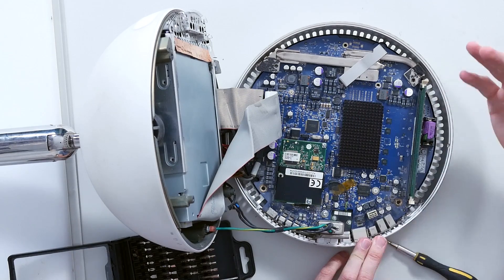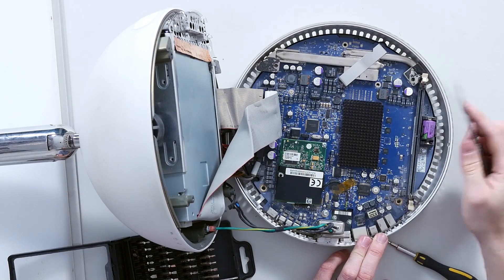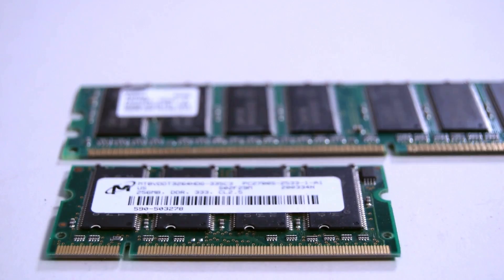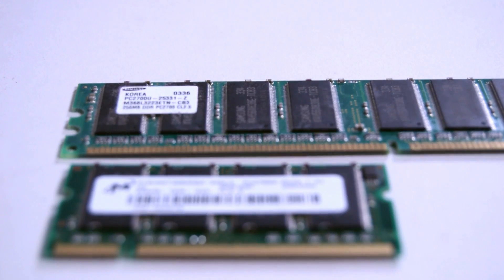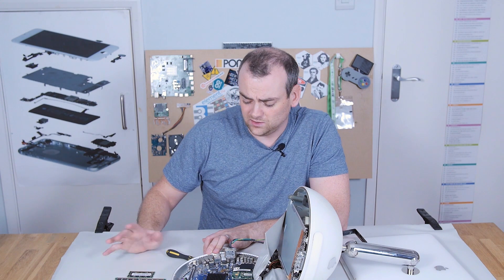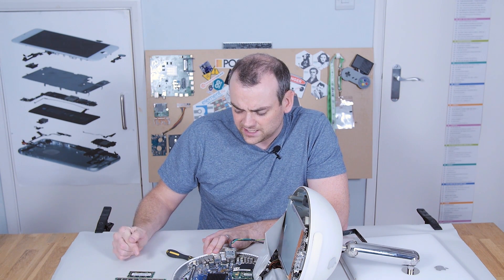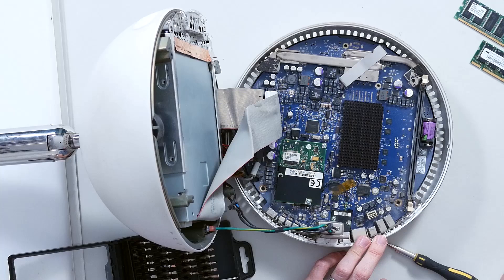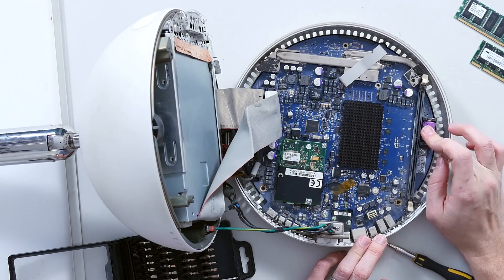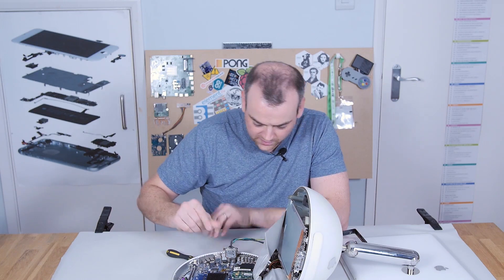This is the logic board, or essentially the computer, and straight away here is a full-size DIMM — dual-inline memory. I can't think of another device where DIMM and SO-DIMM are used simultaneously, because it's not like one is a graphics memory upgrade. This is system memory, but it's combining DIMM and SO-DIMM, and I find that unusual. Also in here you can see the system battery. I wonder if that's good, because if this battery's failed — that's entirely possible — that could be a reason why it might not want to boot.